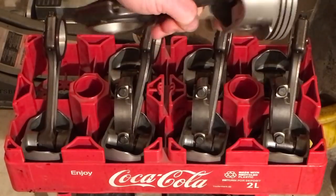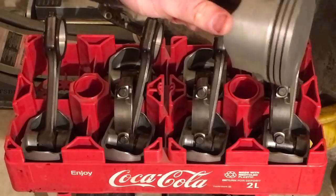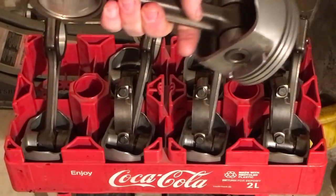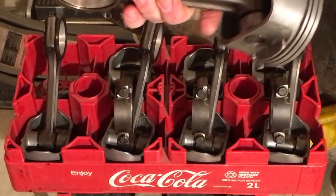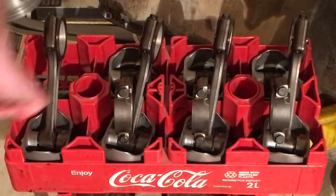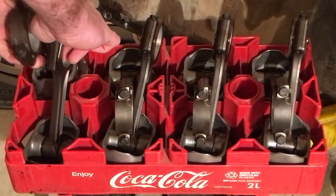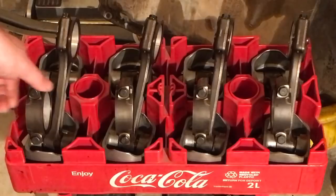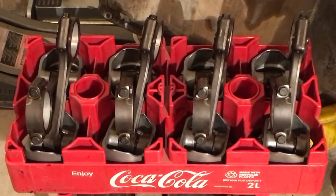I've got the pins oiled. That's something you guys need to remember when you're cleaning your pistons up. If you expose them to water of any kind or any amount, be sure to lube that pin when you get done working on it. Those things will rust inside of there and get stiff — they will literally get stiffer than you don't know what if you don't keep those pins lubed during the process.